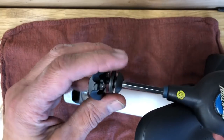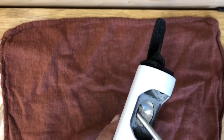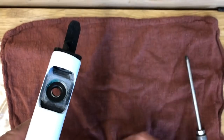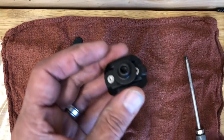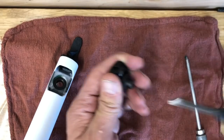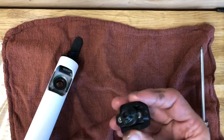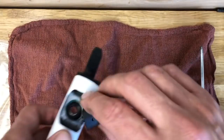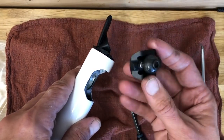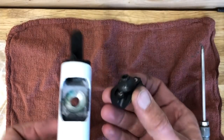Basically what it's doing is just pushing that little wedge piece into the front edge of the frame. I went ahead and put some grease on all this stuff — for me, without grease it can't quite get tight enough, it kind of binds up before it's actually tight enough. It feels like it's tight but may not be. Greasing also avoids potential creaking in the future and potential difficulty with disassembly, especially when dealing with dissimilar metals over time — a little water in there can kind of fuse everything together.